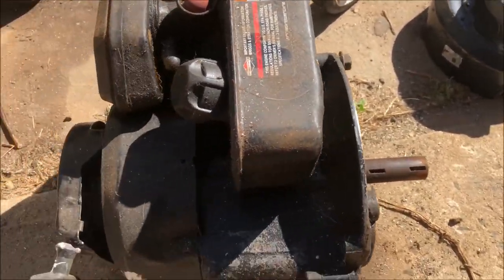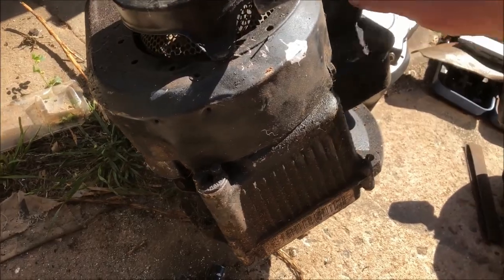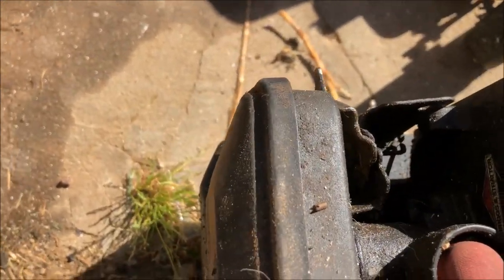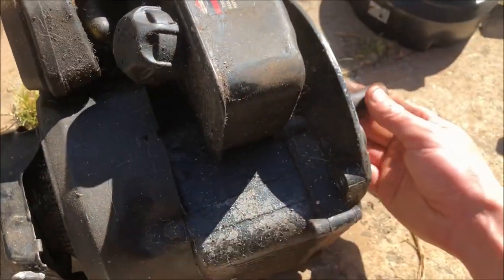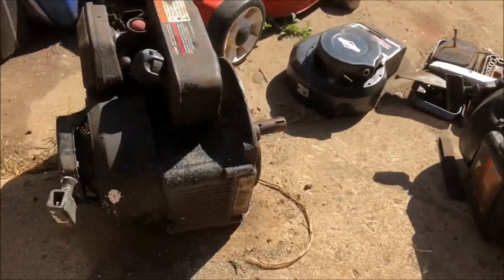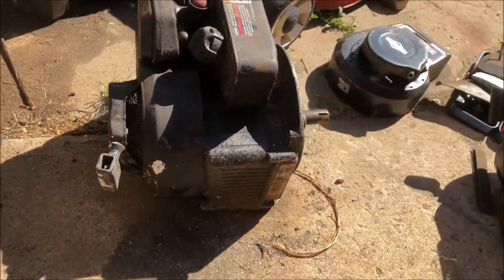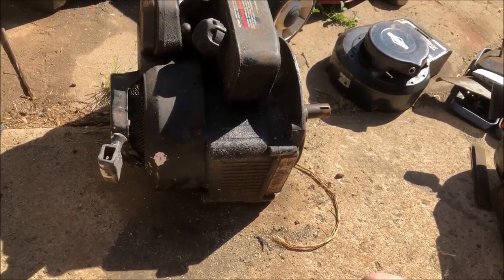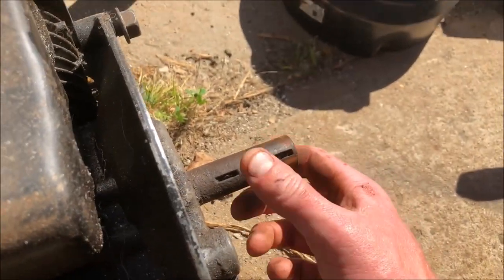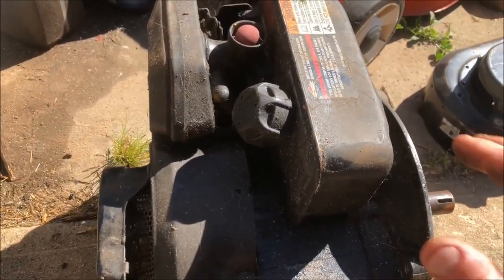Here's our replacement engine. I'm not sure what the story is with this one - it was sitting out the back. It's got a little oil all over it, might have a broken inlet manifold or just missing some bolts. But it doesn't have any bad sounds when you shake the crank back and forth, so we'll just wing it and go with this one. Worst case, pull this one back off and try another one. I'll get some emery cloth and clean up the crankshaft, fit up the boss, and fit it on there, then worry about the top half later.